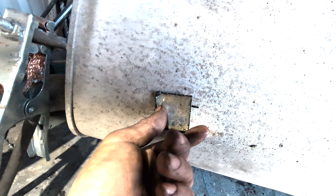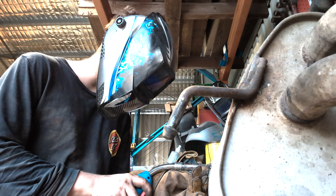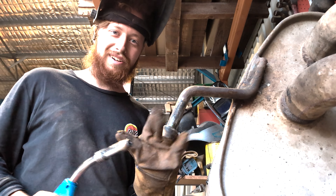Very simple trick. I've just cut a square patch — I'll just go like that. I'm not even gonna clean it up, I'm just gonna weld around it, then clean it up a little bit with the grinder when I'm done. That's all I really need. Doesn't need to last long, just needs to last a couple more years. It's a car that costs 30 bucks a week to drive — costs nothing to buy, nothing to keep registered. It's the perfect daily. That's why we're never modifying it. Never.